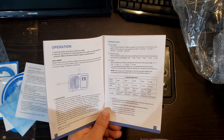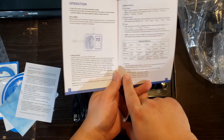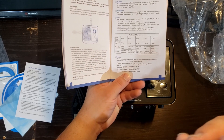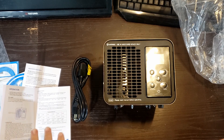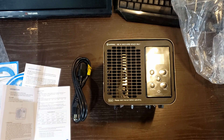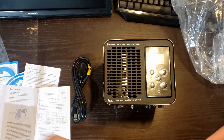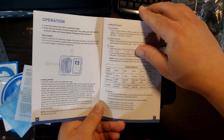Here's a little chart to consult when you want to make sure you're doing it right. The timer controls how long it runs. The interval controls how often it produces ozone - you can set it to produce ozone for one hour every 12 hours, two hours every 12 hours, one hour every 24 hours, or two hours every 24 hours. So if you set this up in a shed and set it to produce ozone for one hour every 12 hours, come back in two days - it's done four ozone cycles and gotten rid of whatever lingering odor was causing the smell.